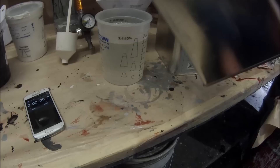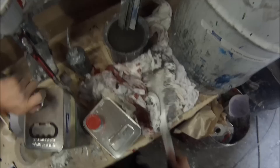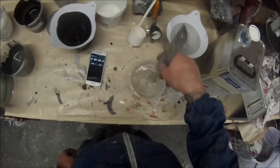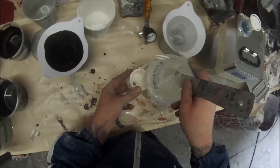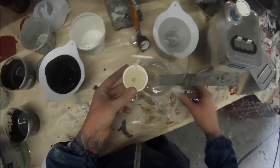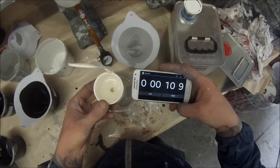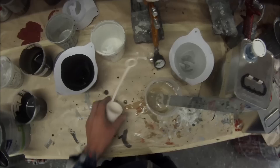I was actually a little bit surprised by some of these results, being that most of the time I don't even use viscosity cups. I thought it may have actually needed the 5% reducer because sometimes out of habit I just put a splash of reducer in because it's what we always do. It turns out this actually ran through quicker than the recommendations without any thinner at all - 15.5 seconds. Between 16 and 18 seconds was what it said on the can, same as the other clears and base coats. You can't really make it much thicker than that as you've already got no thinner in there and you've already mixed it up at the correct ratio.